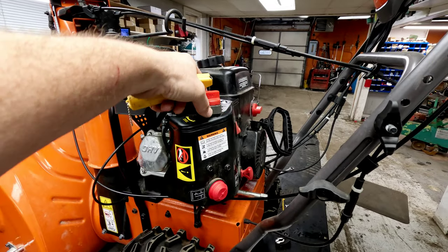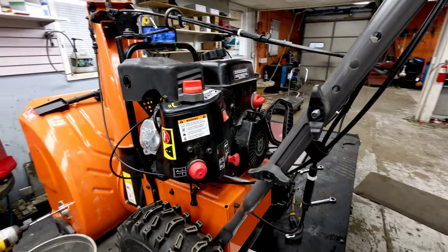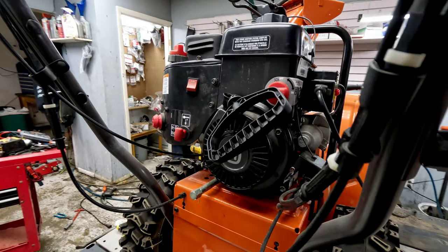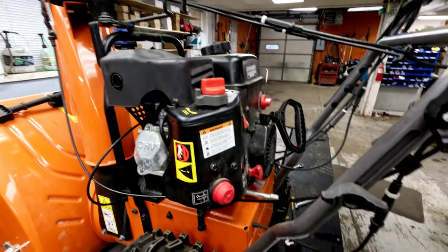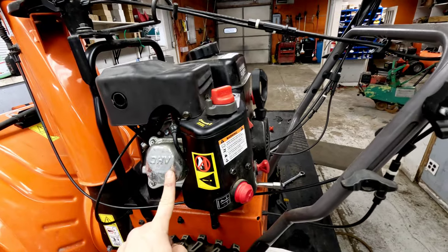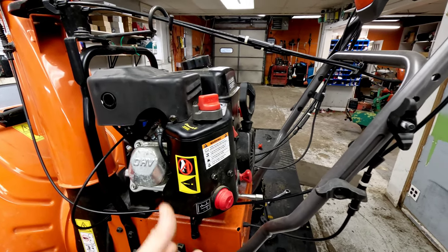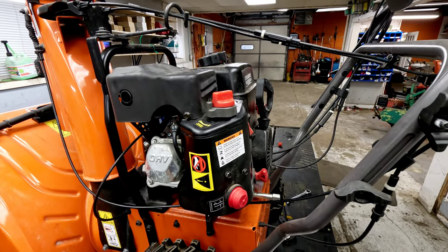It's a little bit different than a lot of models in that it has an adjustable throttle right on the front. Many of them don't have an adjustment where you can actually throttle down. The Husqvarna part number is 9619-30096. We know we're getting good spark, and we think we're getting compression because this thing was running okay before. The carburetors on these gum up real bad, especially if you're using anything with ethanol in them — very common issue and the most common issue.